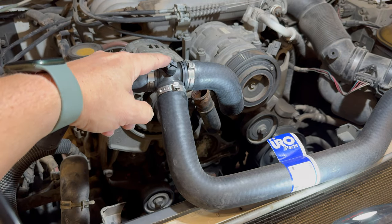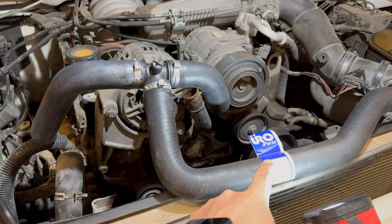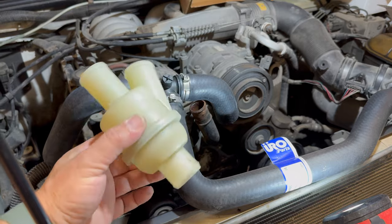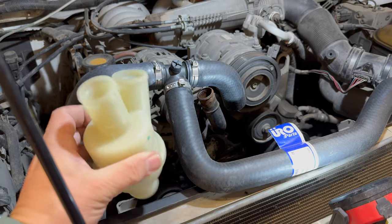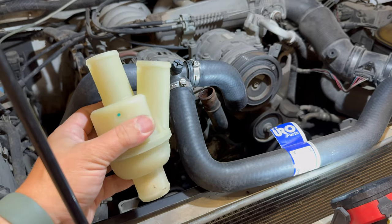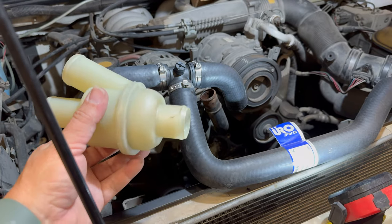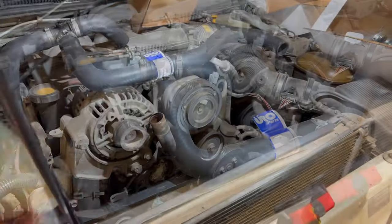We'll be eliminating this plastic piece. The original hose also had a plastic bleeder right here, which was actually broken and leaking on this Land Rover. You also get to eliminate the plastic thermostat. When I was undoing the original hoses from the thermostat, they were really really loose on the plastic thermostat — no wonder they were leaking. The thermostat that was in there was all green from antifreeze leaking. It's probably just better to eliminate all the plastic parts in your coolant system.